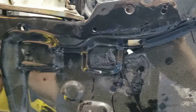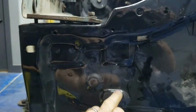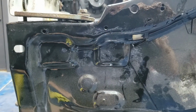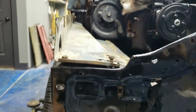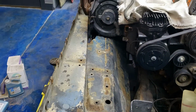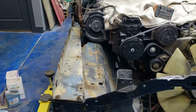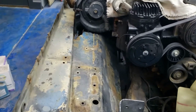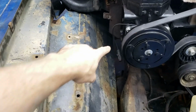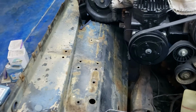Actually, you know what? I'll take a look at it. I might just be able to put nut certs on the liner itself and just put bolts through from this side. That would work good too. So nonetheless, I'll have to do that, and then should be ready to weld that bracket on the back there, and then wash it off, scuff it up, and throw some paint on for now, because I know I'm probably gonna have to come back. Once I put all my airbag stuff down in here, I'll probably have to come back and cut some more, but I can always touch that up.